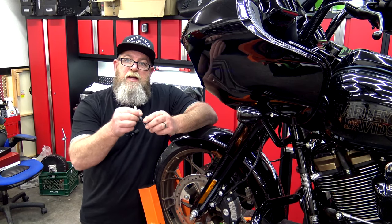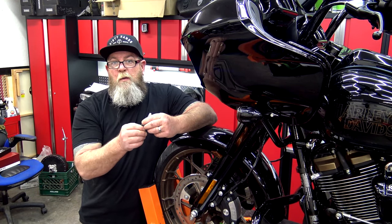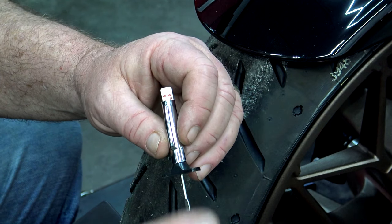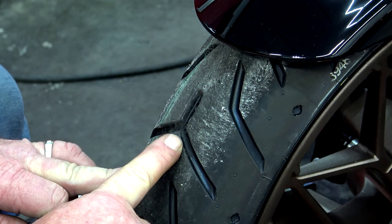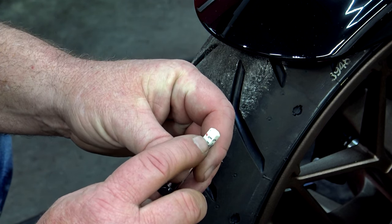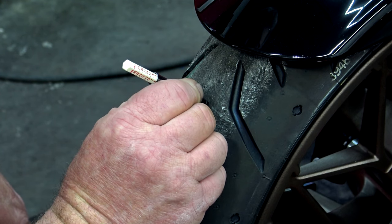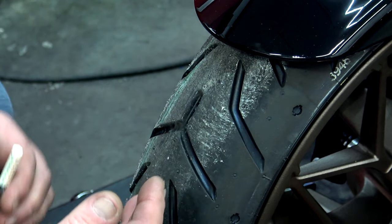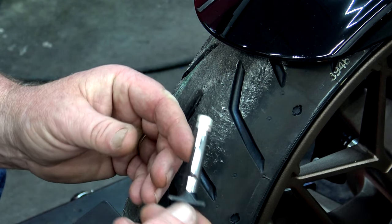Check your tire tread depth. We have a little tire depth gauge right here — I'll put a link to this in the description; you can get this on Amazon or pretty much any automotive parts store for a few bucks. You can use one of these tread depth tools or you can do the penny test — you can Google that. On motorcycle tires we're looking for a minimum depth of two thirty-seconds. Personally I don't go any further than two thirty-seconds. The tool has millimeters and thirty-seconds marks on it. Go to the center of the tire because that gets the most wear, push it down, and look at it. We're showing five thirty-seconds on this brand new tire.